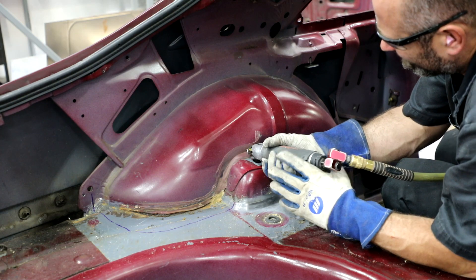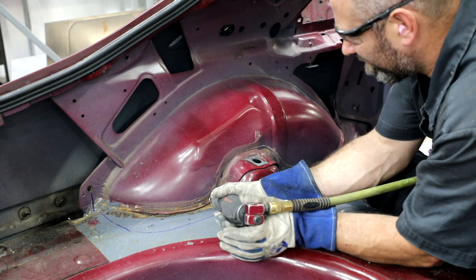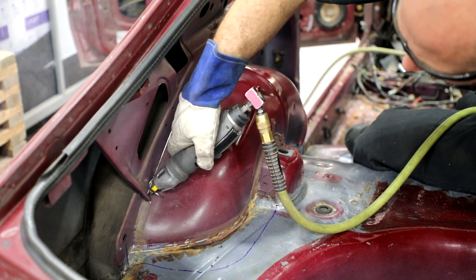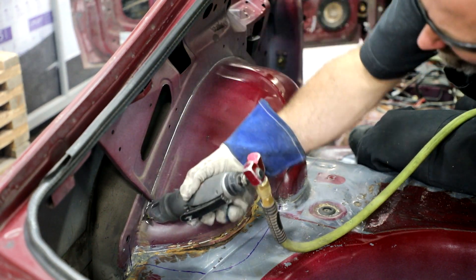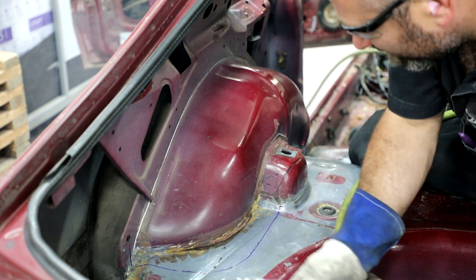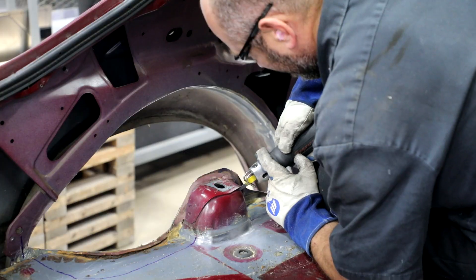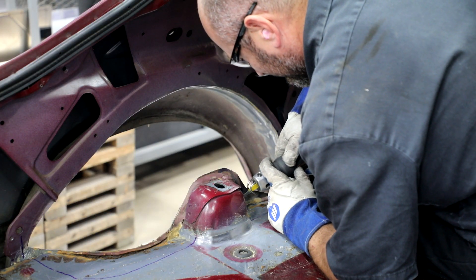Remove the template and use an air saw to cut the inner wheel tub out. Make a cut at the bottom of the inner wheel tub above the trunk floor and around the profile of the upper shock mount. At the front of the inner wheel tub, cut around the rear seat belt anchor and leave the inner flange where you exposed spot welds from earlier. Then cut around the top of the inner wheel tub on the inside of the flange.